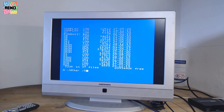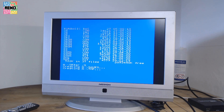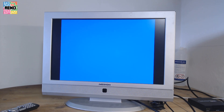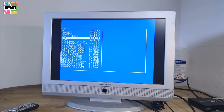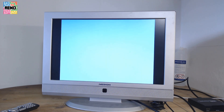We don't want the splash screen. Upon first start, it creates directories for saves, temp, and the settings. And there's our menu. Remember, we are in the SR directory, so we have to go up one directory, go to the games folder. There's our Mappy ROM. And instant loading! For a better user experience, we'd like to auto-start SofaRun, and of course I'd like to put some more games on it.